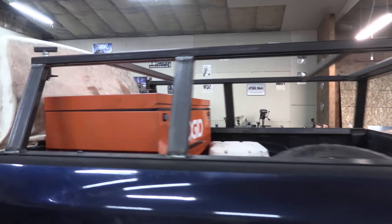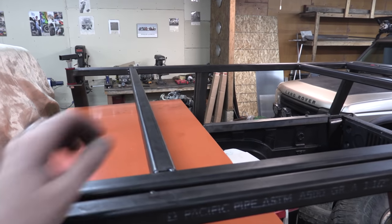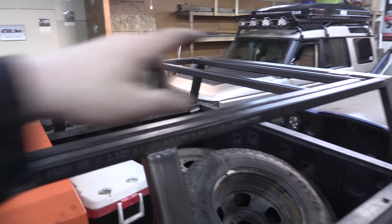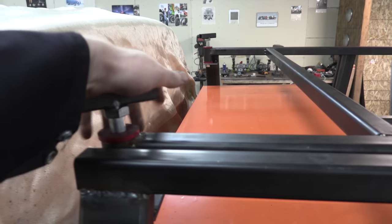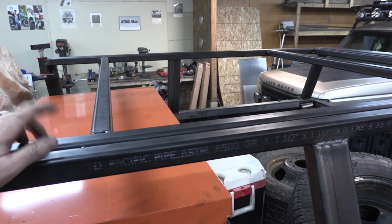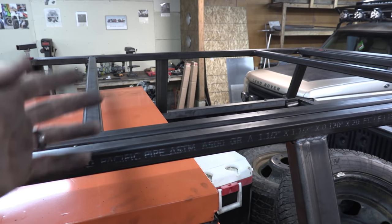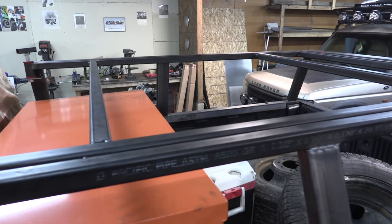This was so easy, and it would be even easier if you don't want this inside piece. Most people don't need the tent to be able to raise up like I do. The basic concept: I've got two hinges on one side and two latches on the other. These latches are super simple — it's literally a bolt that I tack welded a handle to, with a nut tack welded on the bottom side. Right now it's ultra light, but once we get a 150 pound tent on there it won't go up and down so easily. My long-term plan is to add some sort of hood shock system like you'd see on a big heavy truck hood, so once I unlatch it and push it up, it'll assist in lifting the tent and keeping it up.